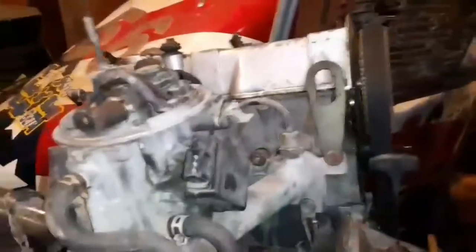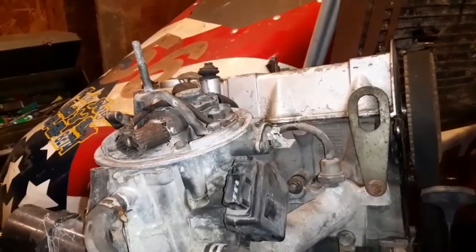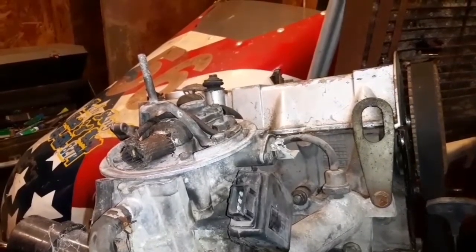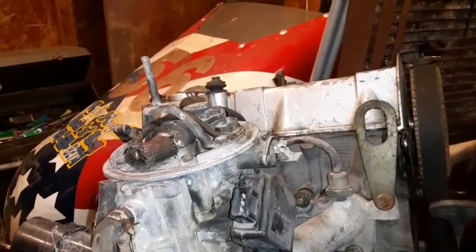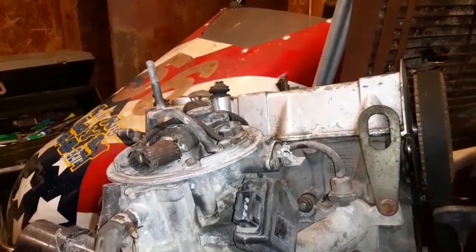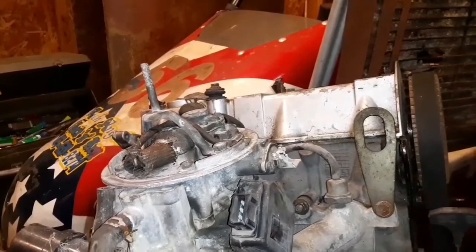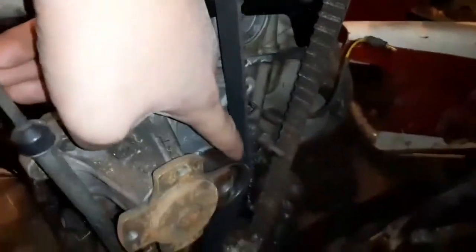And the entire time that I can remember this car running, it had a very loud timing belt. That was because they were running the belt so tight to try to keep it from slipping, when the real problem was it had the wrong cam gear. There wasn't nothing wrong with the belt, but I do need to get a new idler tensioner. It's bad.